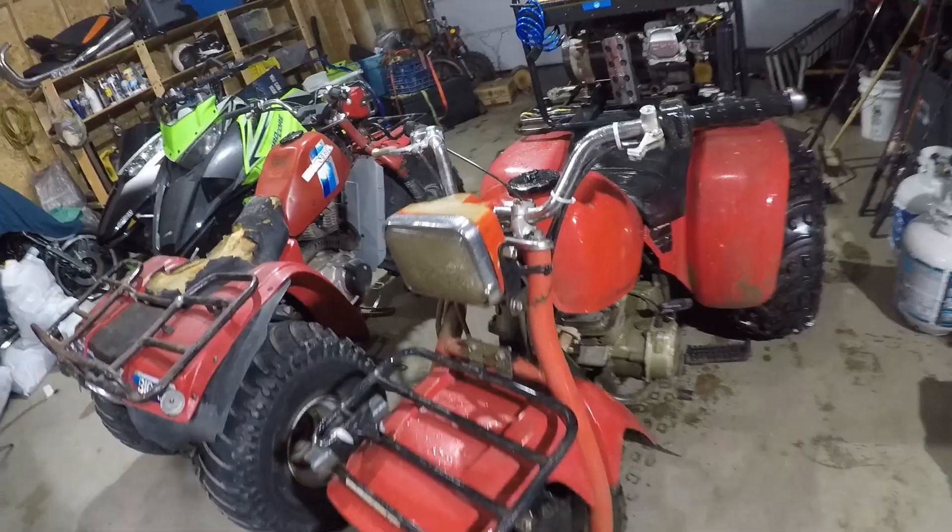It's actually significantly too fast for a 200 — it's geared too high. So in this one I'm going to be at some point dropping a sprocket size in the front to take down the top speed a little bit and give it more torque at the low end, because it chugs a lot once you get it in some mud. I mean, this thing actually did me well — it is running like a freaking top.